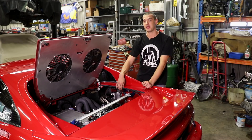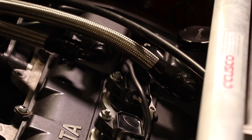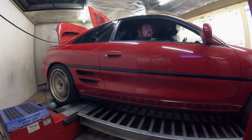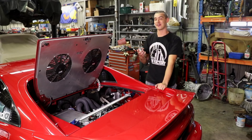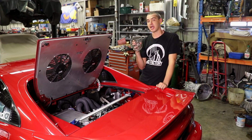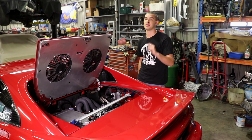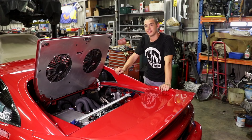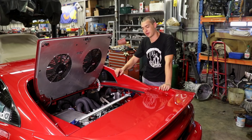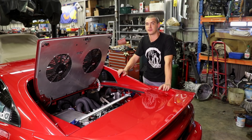Engine management is controlled by a Haltech PS1000. We've got four Toyota Yaris 1ZZ coil packs and the wiring has been all done by Al. We had some triggering issues — it originally had an aftermarket crank trigger wheel, 36-minus-2, which we then cut down to a 12-tooth plus one on the cam, which made it better but didn't fully fix the high-RPM noise problem. So we ended up using the standard distributor, which is 24-plus-1. In hindsight, the problem was most likely due to the hall effect sensors supplied in the kit — they're probably not suited for automotive application. The standard reluctor 24-plus-1 works fine and is faultless in this application.